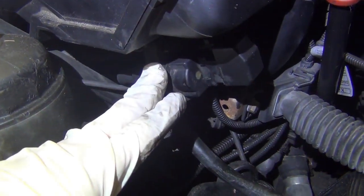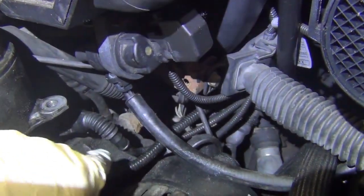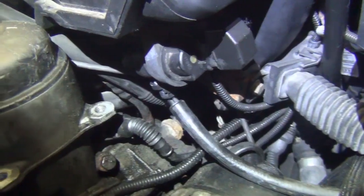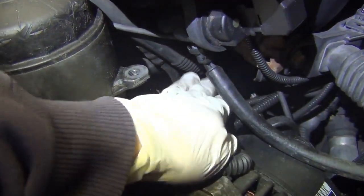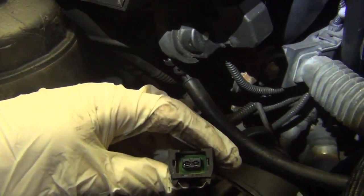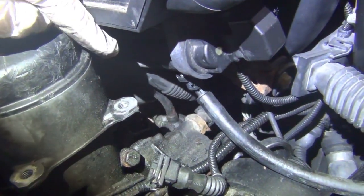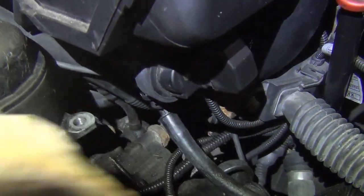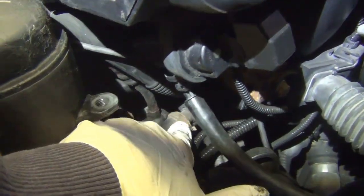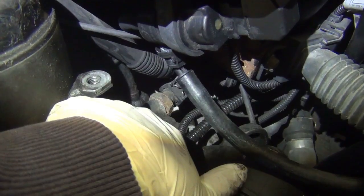You can see here's the purge valve. You have an oil pressure sensor and a temperature sensor down here. You can unplug the oil pressure sensor — this one has two pins on it, just a press clip. You don't have to unplug it, but you can differentiate between the two connectors by how many pins each has — the oil pressure sensor has two pins, the temperature sensor down here only has one. Now this is your banjo bolt right there. You might be able to get to it by putting a wrench right through here, or we can take the sensor off, which would open up more of a direct shot.